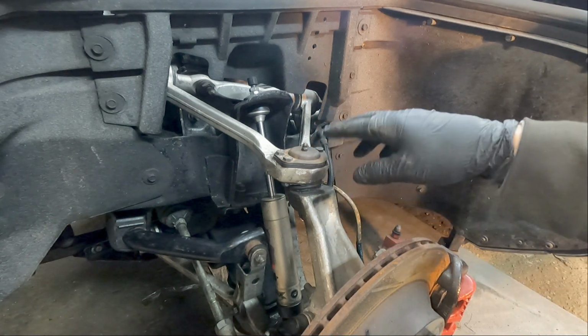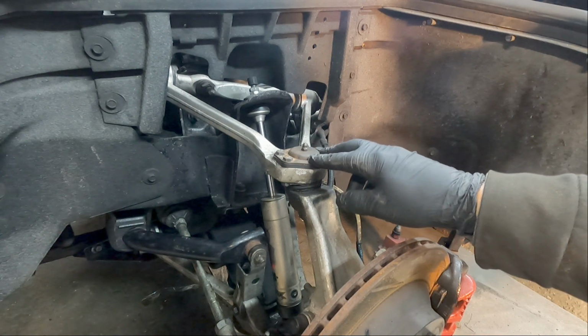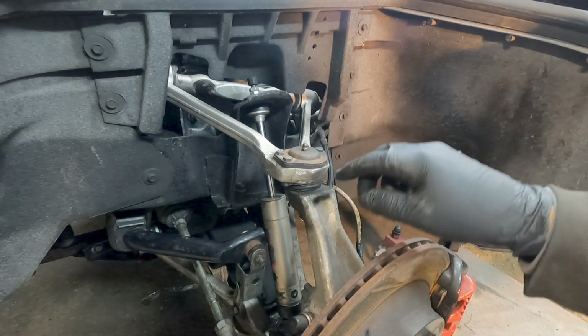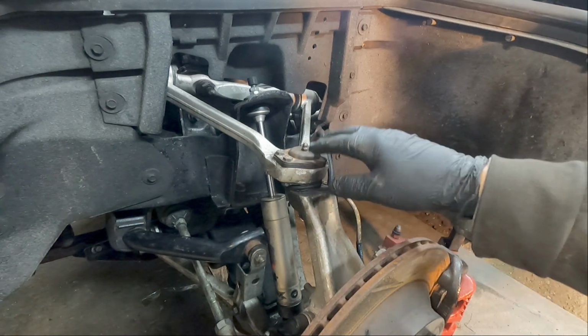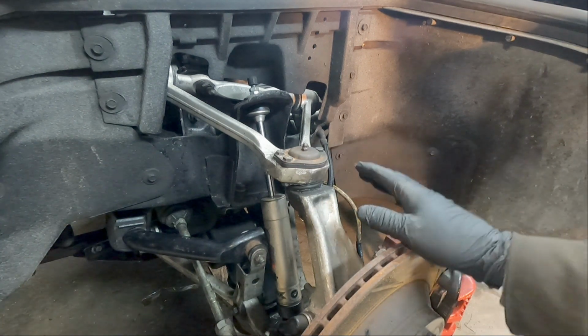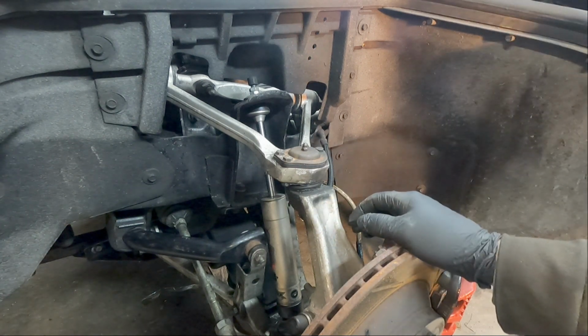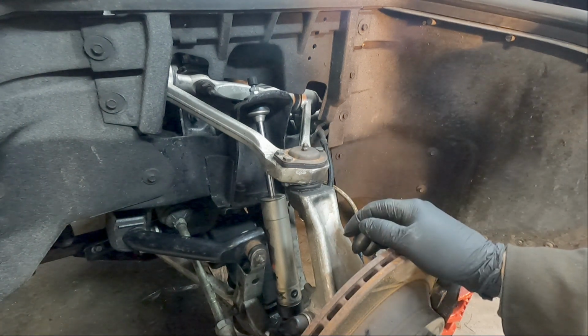When I put them in new, I grease them till the grease comes out. And then after that, when I grease it, I'll put 2 to 3 pumps in each one. Usually 3 pumps. And that's it. I don't worry about pumping the grease out all over the place, and it makes a mess. That's a personal preference. How you want to do it is up to you.